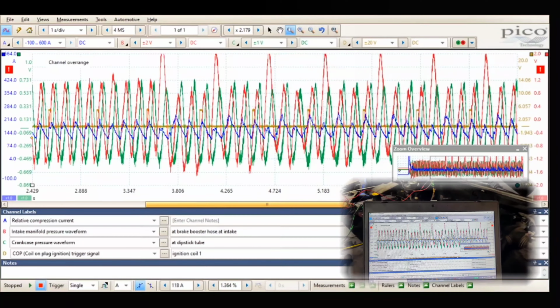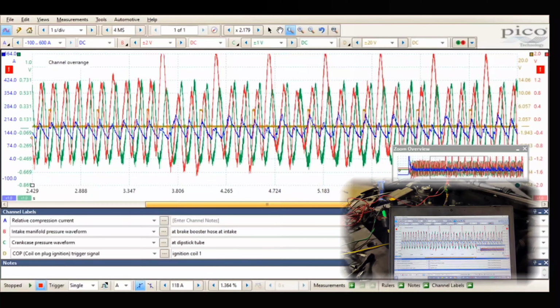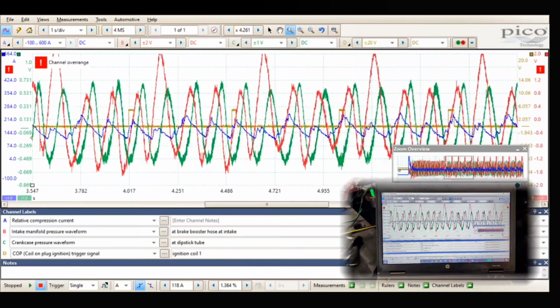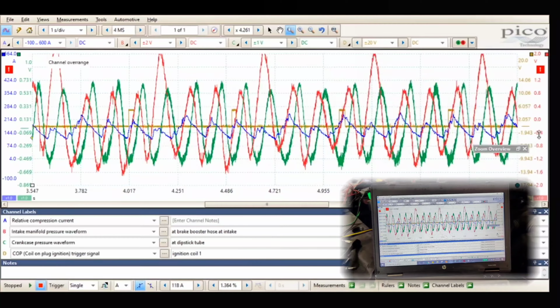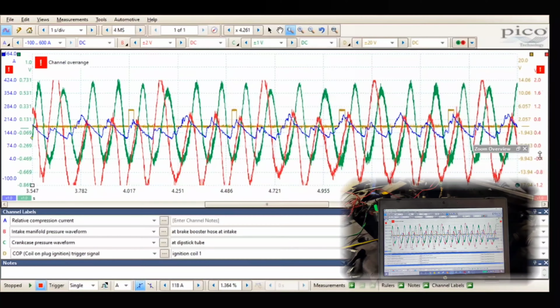And our red tracers are intake pull. So we have an intake valve issue. Which one is that? What's our firing order? That's awesome. I did not expect that, guys. Looks like we might have to go to a higher voltage scale.